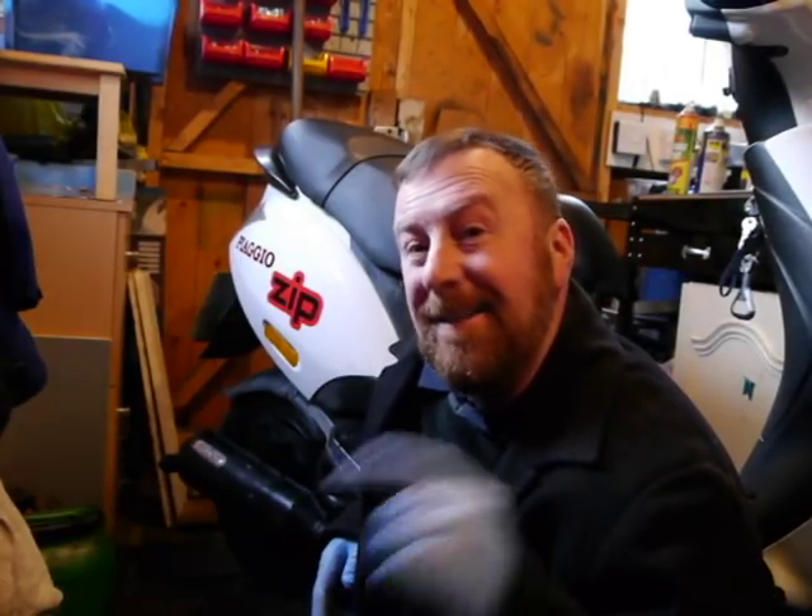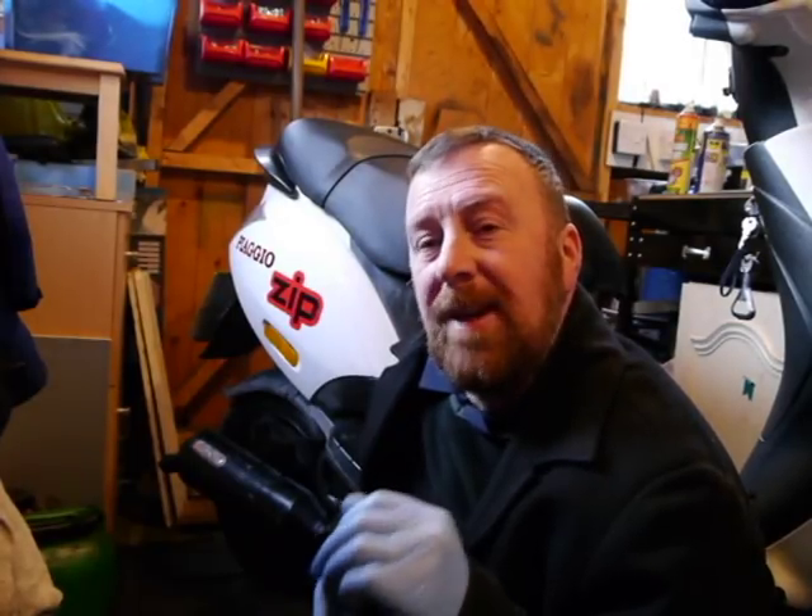The person at the shop decided to sell it and had put on an old rusty exhaust. These exhausts do get rusty - they're going to do it anyway unless you get top-of-the-range ones, and they still rust. The person said they didn't want that exhaust on it, so the shop put a standard exhaust back on - and that's when the problems started. They didn't down-jet it, so it had too much fuel going in.